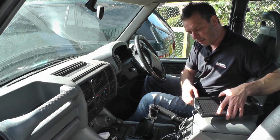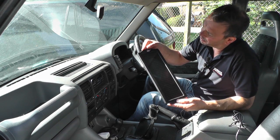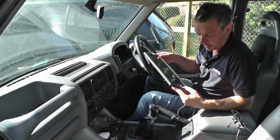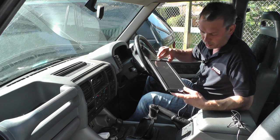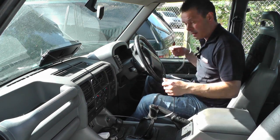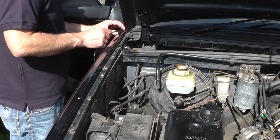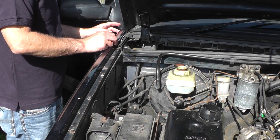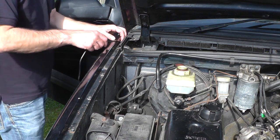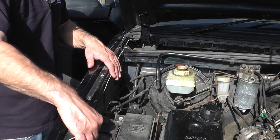We've popped the bonnet and before we actually attach the crocodile clips to the battery I'm just going to tease this out. We've already fitted the little suction cups to the battery maintainer itself, and once it's under power there's a little blue LED flashing. I'm going to place it on the windscreen and then run this cable through the door and into the bonnet bay. The great thing about this Discovery is that the panels have gaps you can put the wire into, so you can run it alongside the door without any issues with trapping the wire. Then I'll slot it down into these convenient gaps and run it down towards the battery before attaching the crocodile clips.